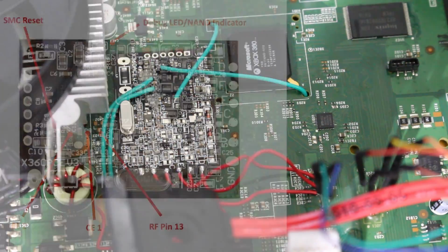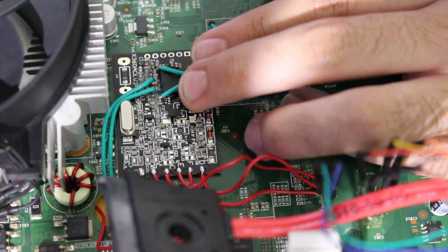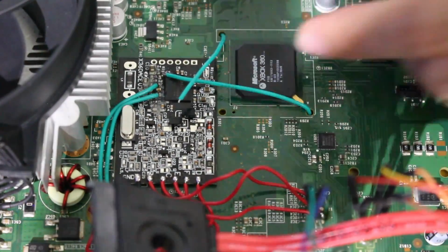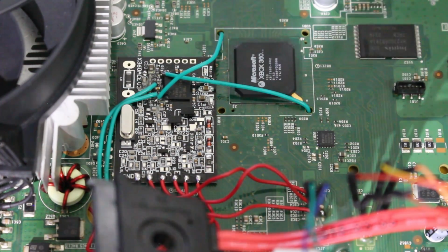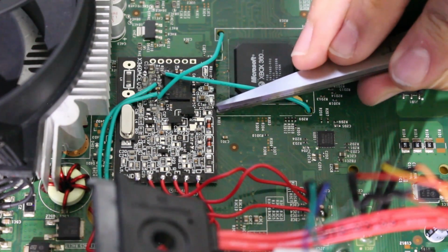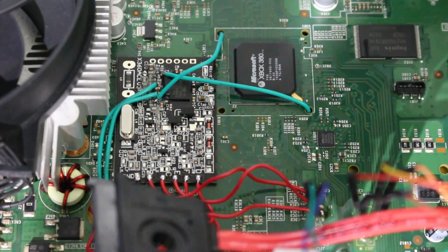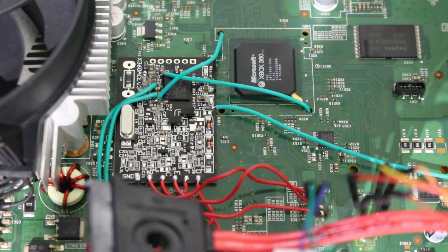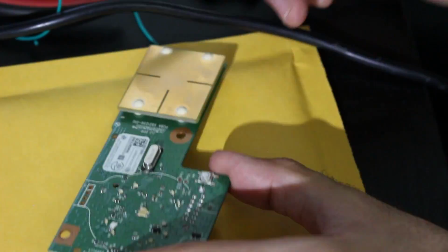The thing that actually fixed up the system for me was I had to then go in and reflash the glitch chip itself. So the X360 Ace V3, I ended up reflashing with another timing file, and then after that, everything worked. I ran it by Element, and he said that this is actually an issue that he himself had not run into, but he was running into a few faulty boards with the X360 Ace V3, so it's a little bit of a quality control issue with the glitch chip itself. I'm confident it had nothing to do with the Viper, because as I said, after I reflashed the glitch chip itself, which the Viper does run through, everything worked just fine.